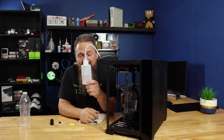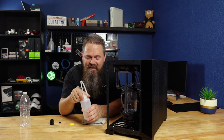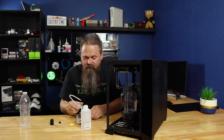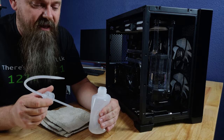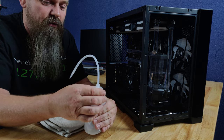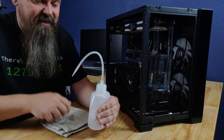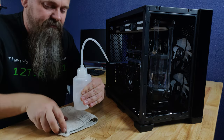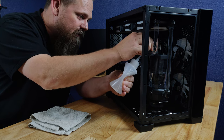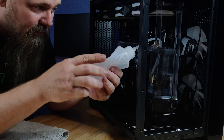Now, as you can see, the fill bottle is about half full at this point. However, if you actually try to squeeze the bottle now, you're just going to squirt fluid out. So, take the cap off of the fill bottle — this is another good reason to have a towel laying around so you don't get fluid all over the place. Go ahead and squeeze the fill bottle with the cap off, making sure you don't squeeze it enough to where the fluid comes out. Then go ahead and stick the cap back on. While you're screwing this on, be really careful not to squeeze the bottle any more than you already are because you're going to make fluid leak all over the place. Once you've done this, take it and be really careful not to get any fluid on anything that isn't supposed to have fluid on it. Stick this back into the fill port and make sure it's submerged in the liquid, and let go. And once you do that, it will start sucking more fluid out.